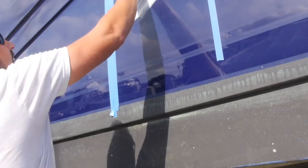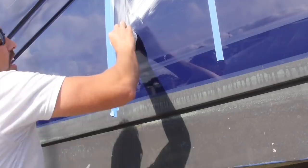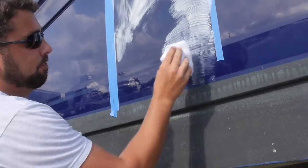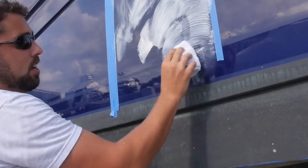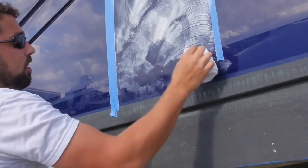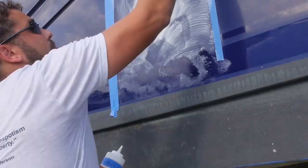We're going to have to do at least three passes to get this looking halfway respectable. It is very hot — I'm not sure if you can see me sweating, but it's 3:30 and the Florida sun is beaming. You'll notice when I apply, I do a little tap, tap, tap. Almost all of the compounds we use are a diminishing abrasive. That means the grit in the compound starts off large, and as we work it — as we're buffing — that molecule, silica, whatever it is, is going to break down to make a finer and finer polish. So it would be like a piece of magical sandpaper automatically going from 150 grit all the way up to 500 grit.